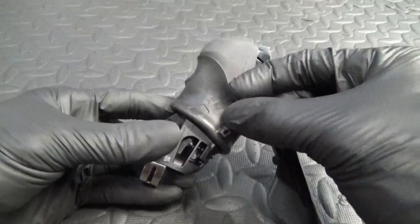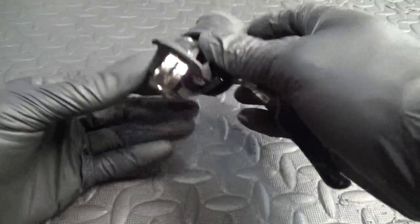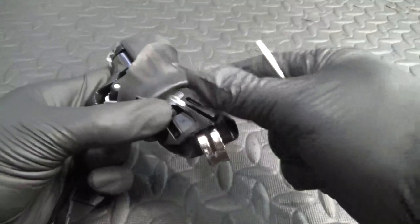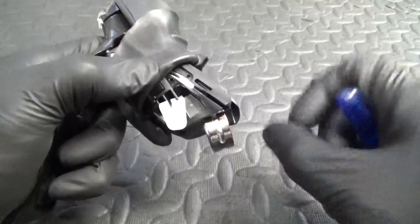What you want to do to start with is pull the hood back — the rubber hood. That's easier to do if it's mounted on a bar. On the inside of the lever, you've got a plastic cover there. You've got to push the hood back enough to see the clear plastic cover, then go ahead and just pop that cover open.